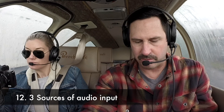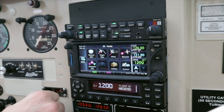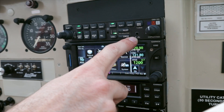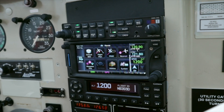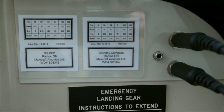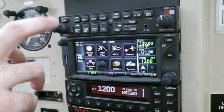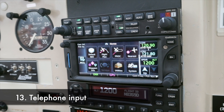To use music source 3, press the music key and use the select key to get to source 3. I've got another source hardwired in — I believe it's source 2. If you pan over to the right you can see a 3.5mm jack right there for plugging in an iPhone or other music source. One difference: the GMA 342 doesn't have Bluetooth audio, but the GMA 345 does have Bluetooth audio.